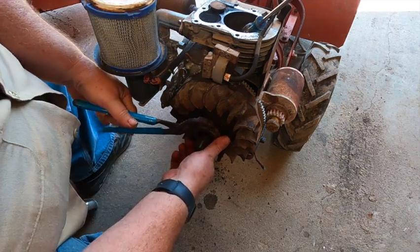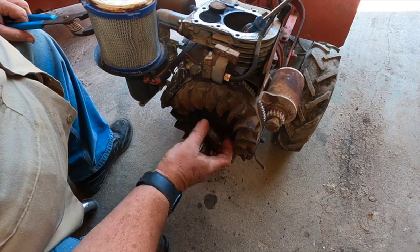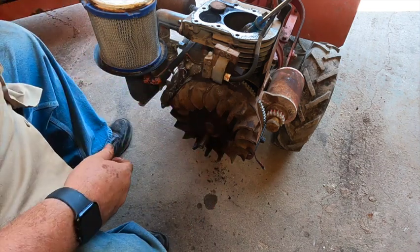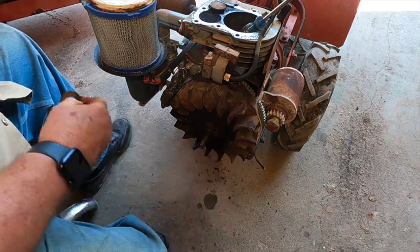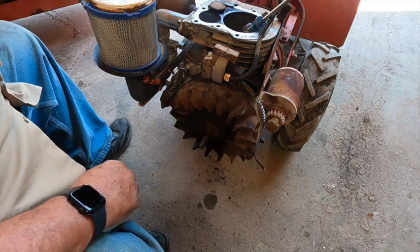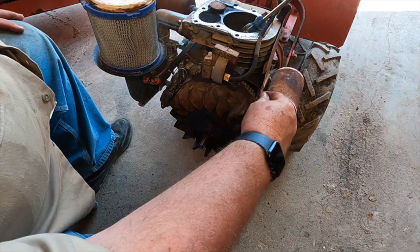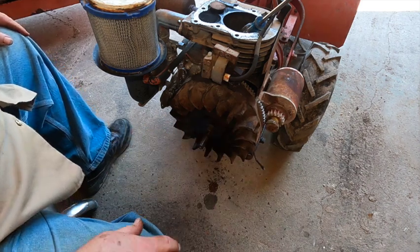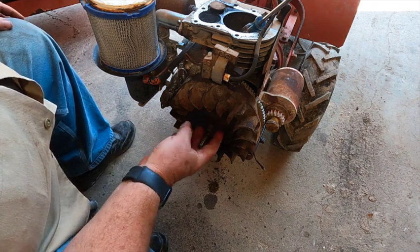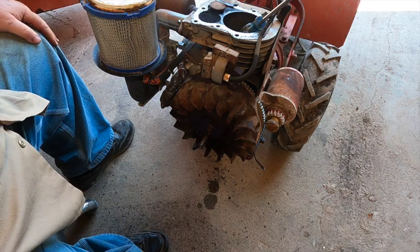The overrunning clutch mechanism just unscrews from the crankshaft. There's a washer I just took off. I'm going to try to put pry bars behind it and work it off - chances of that are slim to none - but I may also take a hammer and a decent punch and try to go behind it. If it doesn't jump right out then I'll have to find a puller that fits. Looks like quarter-20 or quarter-28 bolt holes.